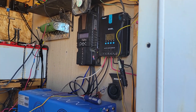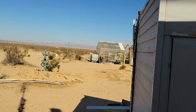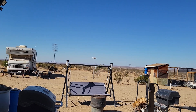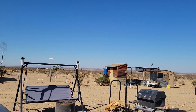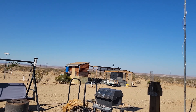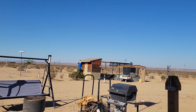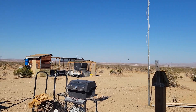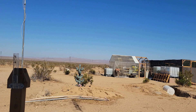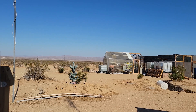I was showing 13.2 inside, and it's saying 13.5 out here, but I'm in good shape with that amount of power. Air conditioning running, refrigerator running, going to turn on the TV in a little while — I'm in good shape. What I was saying in my last video: whatever is going to work for you, you have to do your own math. Put together all the items you want to run and figure out how many watts each one uses. That'll tell you how big of an inverter you'll need, and go higher than that because you might add things down the line.